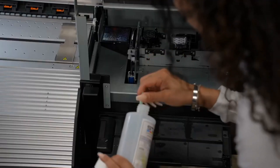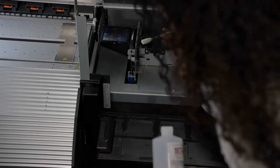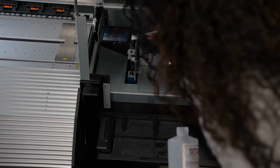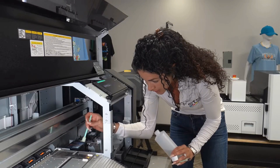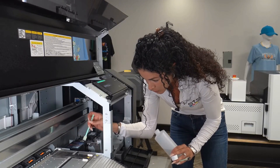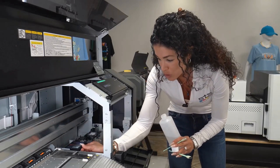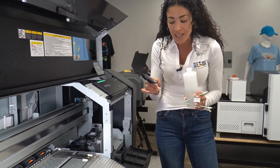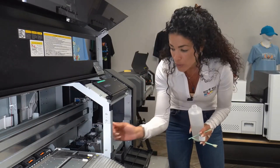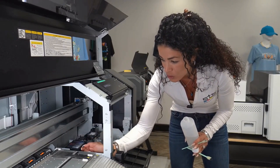Get a new swab and use it to clean the wiper blade — go in here and on the other side. Once that's all clean, remove the spitting pad. Put it under cool water until you see that it's clean, then put it back in the same position as how you took it.